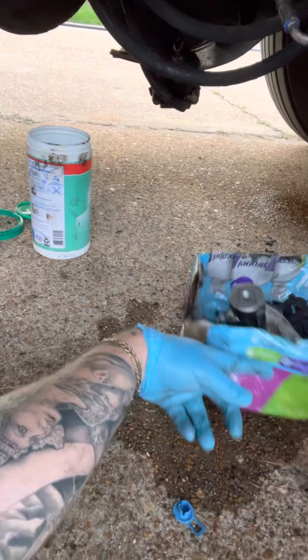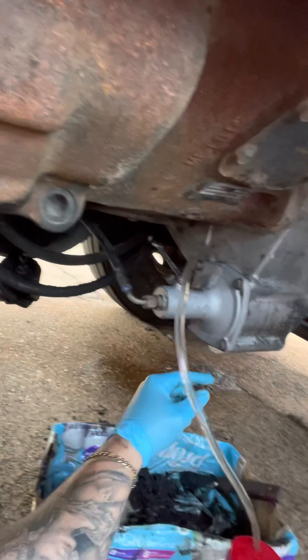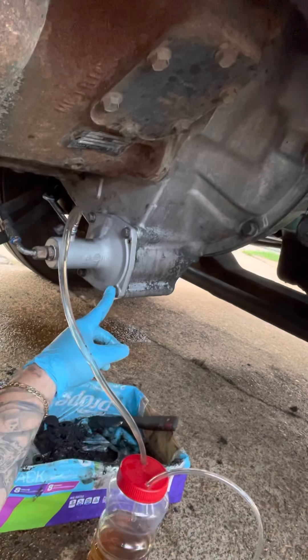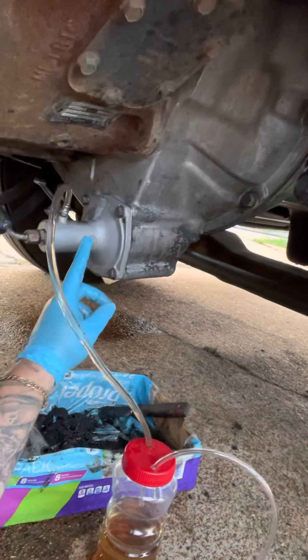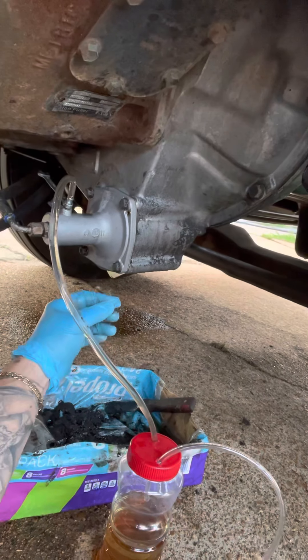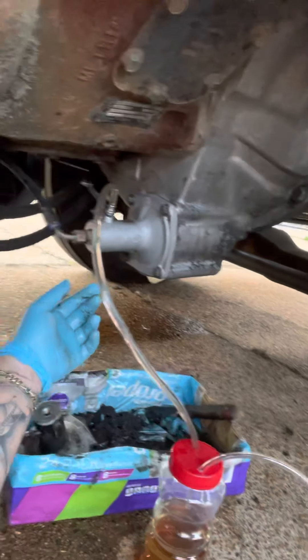That's my bucket full of grease because I changed out the slave cylinder — four bolts. Your slave cylinder is going bad if you check your brake reservoir up there and you've got little black stuff in it. Looks like brake dust or some sort of rubber or something.